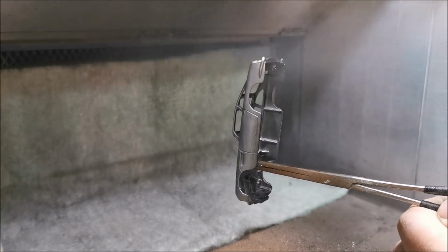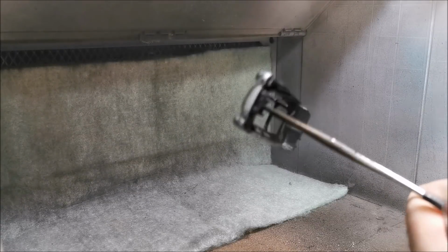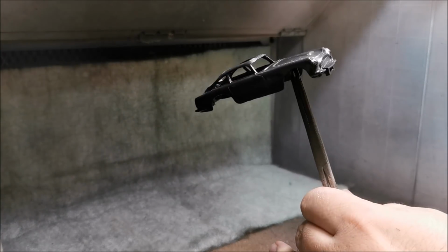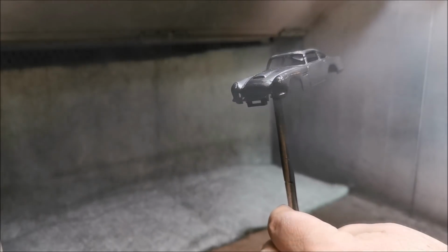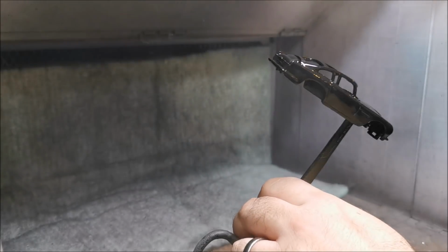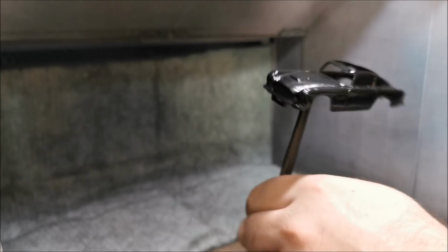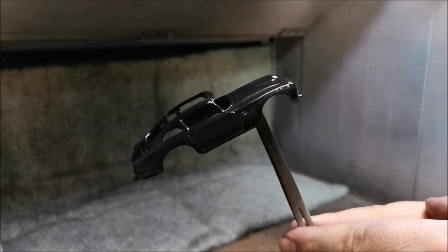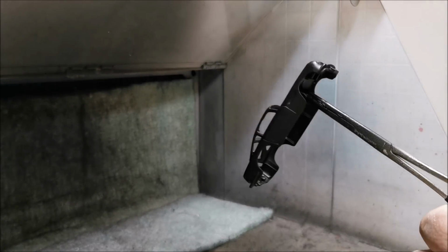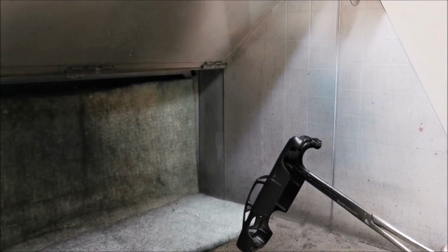We're using the black primer, and I went with 2 really good coats. Again, it was really to help with some of the pitting, but it does dry, and it is a very thin primer, so I don't know whether it really did too much, but that was my intention for a good couple of coats, whereas normally I'll go with just the single. And then once we're dry, looks pretty mean in matte black, I think, but of course this car does need to be in silver.